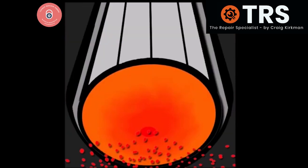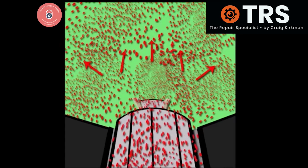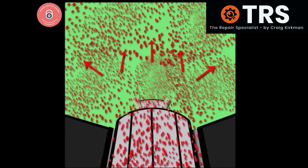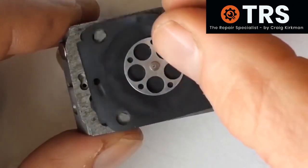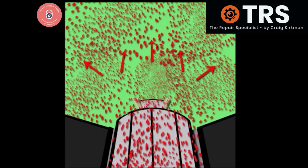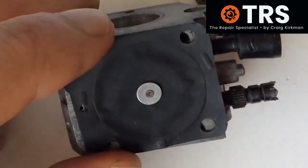The fuel's gone down there and come up to the bottom of this metering needle valve. When certain pressures in the metering chamber above are just right, it moves back and allows the fuel through. The needle valve can move up and down due to this pivoted metering lever — when pushed down at the back it lifts up the needle. So when the needle's back, fuel floods into the metering chamber beneath the metering diaphragm. This area contacts the back of the metering lever to move it up and down. All the time the needle valve and the metering system has been regulating the amount of fuel that comes into this area — and how exactly has it been doing so? Well let's now take a look at the metering system.